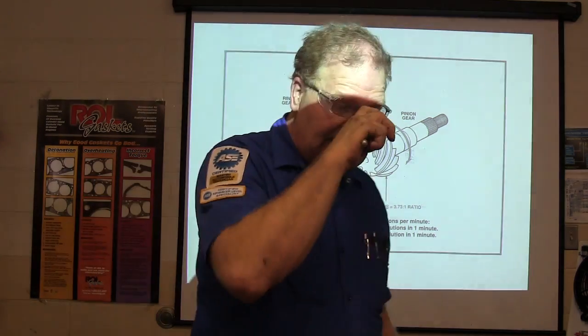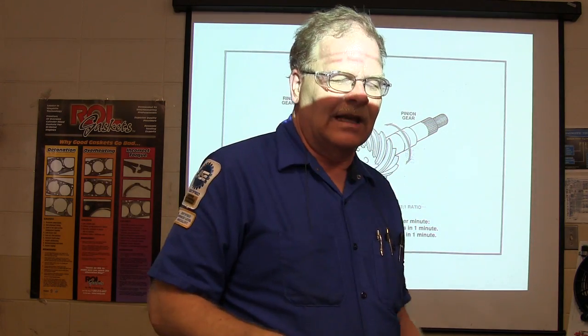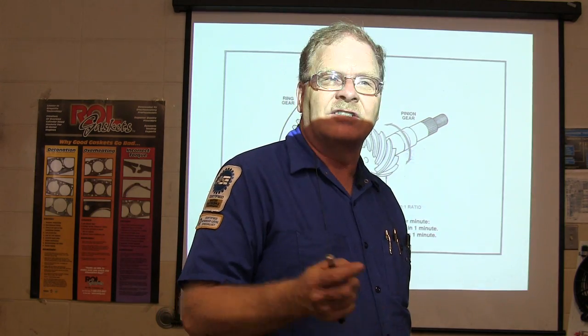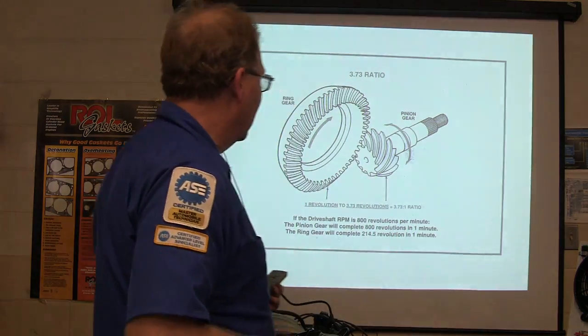It would always lock up when I put it together. So we happened to have a machine shop guy there, and I took the carrier that this bolts to over to the lathe, and I said, chuck this up in your lathe and take 125 thousandths off of it, which is an eighth of an inch. It's good and beefy, you could handle it. When he did that, I was able to put it together and get it working just fine. I don't know what you'd have done if you didn't have a lathe.